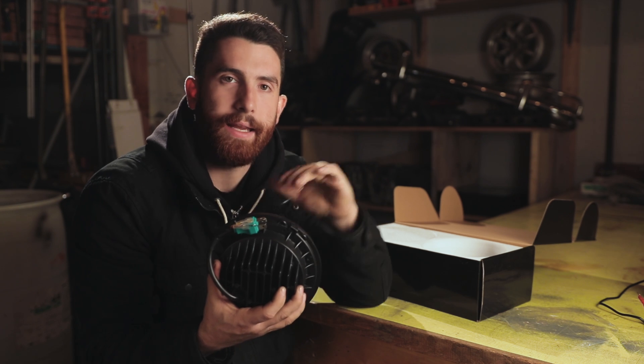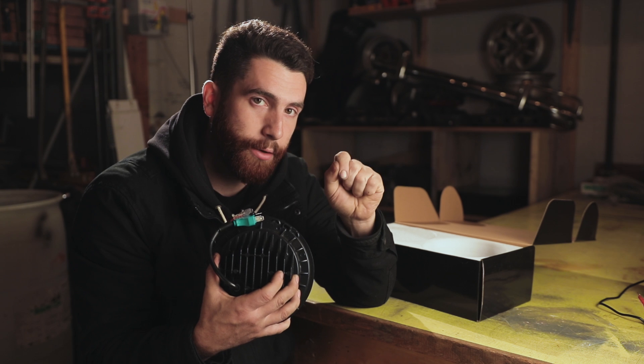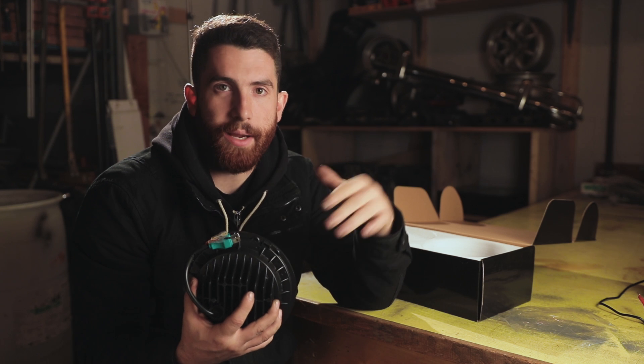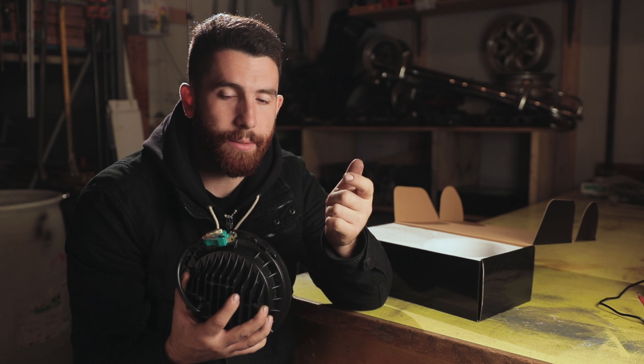Because of the width of this heat sink, if you have the later type of headlight housings where they're plastic in the back — the headlight bucket — there will be some slight filing or trimming you'll need to do just for these outer fins here to be able to fit the bulb. If you have the earlier type that have the metal housing, they fit right in no problem. Just a little bit of clearancing — the plastic's a little bit thicker — so that's something to pay attention to.